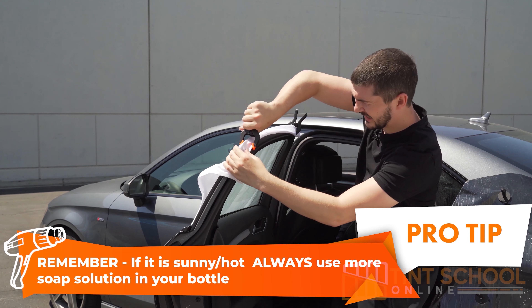Now we're going to peel the backing sheet off the film. The really important thing here is judging the weather and the timing — you're going to have to make sure you pull it when the wind has stopped. If you pull it in the middle of a big gust of wind, the chances are there's going to be debris that gets in the film or it's going to peel the film off the car. First I'm going to spray the outside of the film, then spray underneath it, then remove both magnets. Be very careful that the film doesn't get picked up. I'm going to start peeling at the top. If it is really windy you can flush your magnet into the corner.